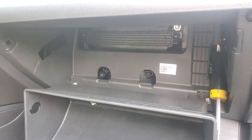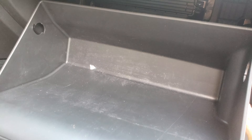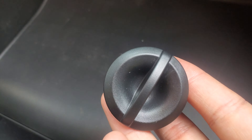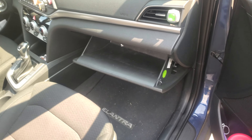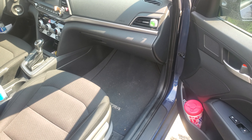That's in there — you just squeeze both tabs on either end. Put this back over here, put the hinge back, and then take these two knobs or locks and put them back. You just twist each one clockwise once. There you have it — that's how easy it is to change the cabin filter on a 2019 Elantra.